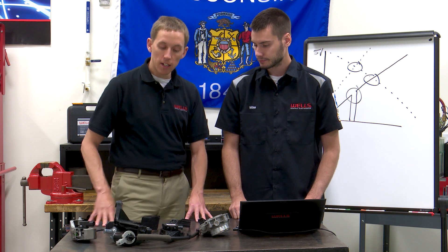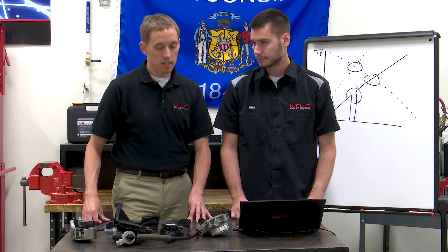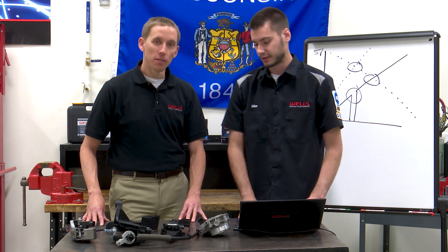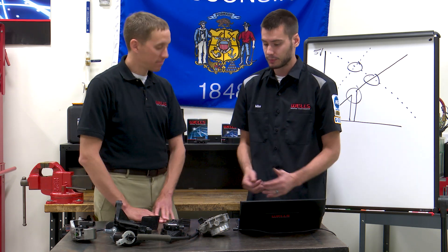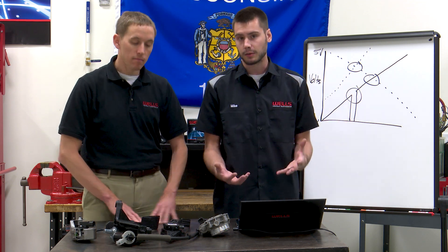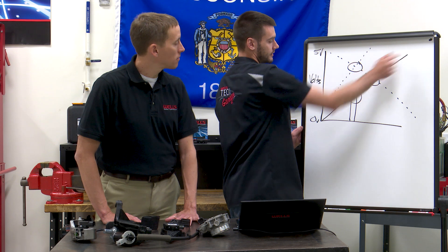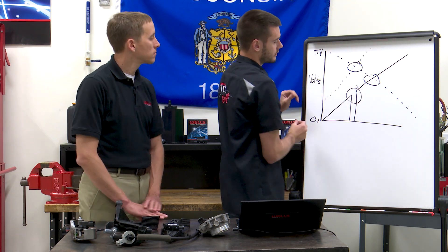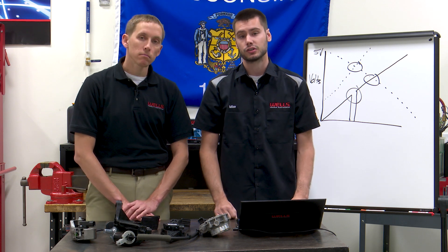This is something you normally don't look at — you don't normally stick your head under the dash and look at these. You think it looks the same as it did in the 90s, 80s, 70s. We used to see a hook on here that you'd hook your cable up to and you're good to go. It's not that way anymore. We get the mechanical aspect out of it — we don't have to worry about stretched cables, rusty cables, or binding cables anymore. Now we have to worry about position sensors and whether they're doing the right thing. Also worth mentioning: it is possible that some APPSs use a three-sensor system. Ford uses three sensors — you'd see scaling zero to five, scaling zero to five going linearly, not always parallel, going at different rates, and then one that crosses. So there are some out there that use three sensors internally, again for verification, making sure it's doing what it's supposed to do.